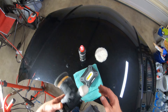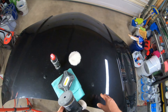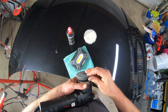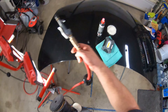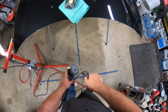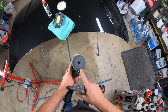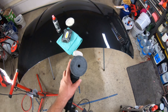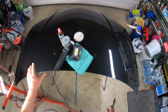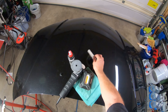So how do I take care of these pads? If this was an orange pad and we're polishing out some minor scratches, we can still use Menzerna 400 or other polishes in your arsenal. You can take your air compressor, crank it down to low, turn it on, and blow it out. You can blow out that excess polish on there — that helps keep the pad clean so it's not getting clogged when you're doing a big surface. Same thing with your wool pad.